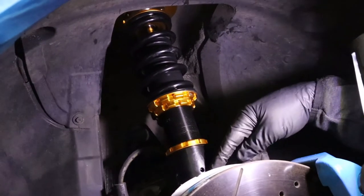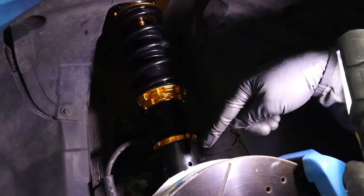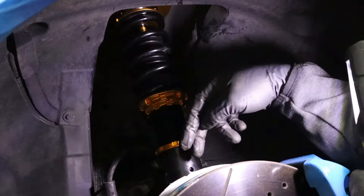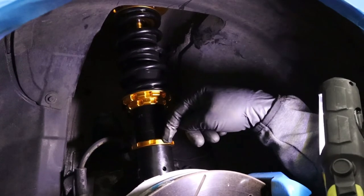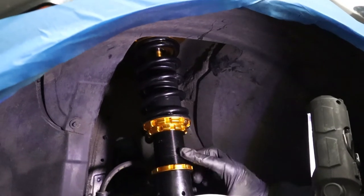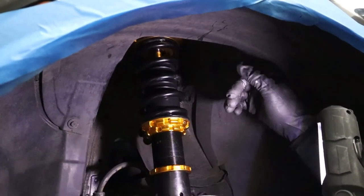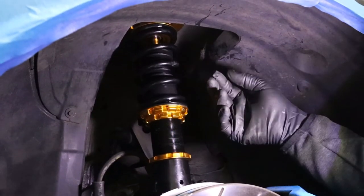The only issue I had was on the coilover strut itself — on the OEM strut there's an indicator of some sort to place into the knuckle. The new one doesn't have it, but it does have two holes that I used as a guide. Everything's bolted up. This is at its longest — the highest it will go — and I needed to do it that way to put in the sway link. Now I'm going to put the wheel on and see how high it is, then do some measuring from there.